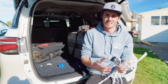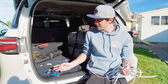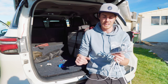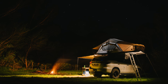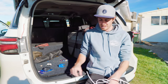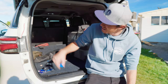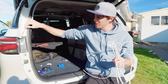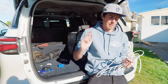Basically I've got some USB ports in a little mount thing and I'm going to stick this on the floor of the tent — I'm pretty sure there's a bit of space around the hinge. I'm also going to modify this slightly to add my tent lights, as I currently have to run a wire out the back door and up through a little gap. It works fine but it's a bit messy and I'd like a plug inside the tent. I've bought some white wire and I'll run it like the other wires up from the tail light to the roof. Those ones control the awning lights and are switched; this new one however is not going to be switched.